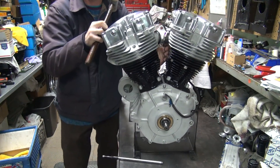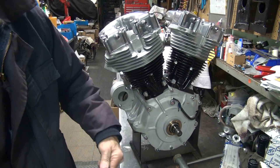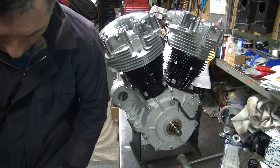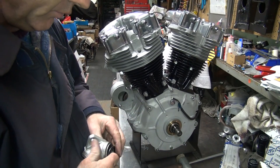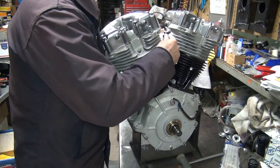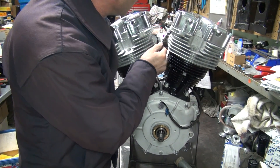Let's tap a little bit with the hammer here. The clamp's too tight — it won't let it go in. Loosen it a bit. Everything falls off on the floor — and we do it again. Put the O-ring on there, hold it, put this one on, put it together. The manifold's a little bigger than the head — that's why it wouldn't go in. Once you're in there, let the O-ring just pop in there. Roll it around your finger a little bit. If you jiggle the manifold, the O-ring will untwist.